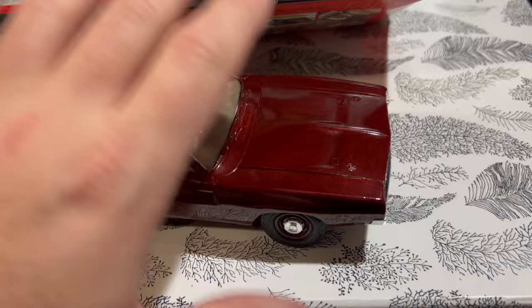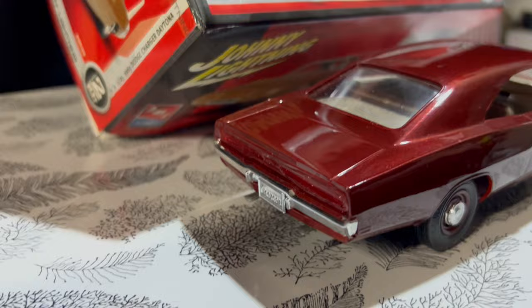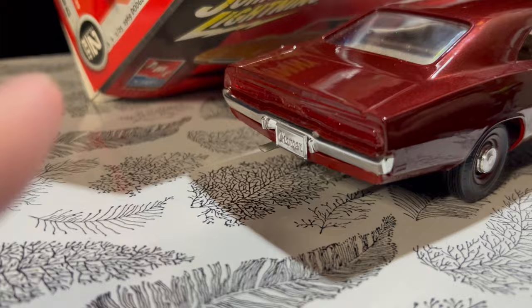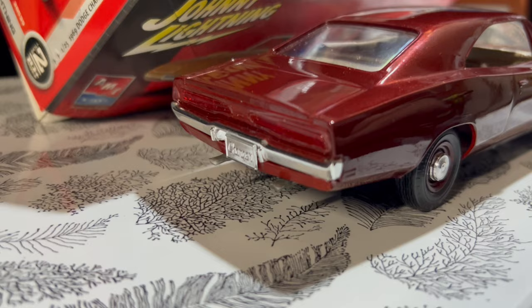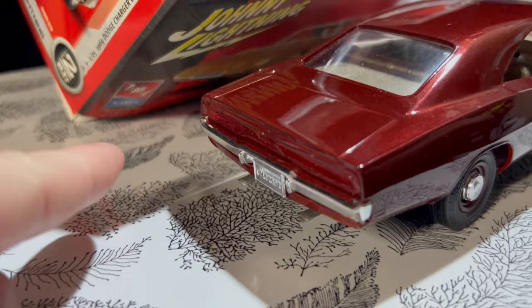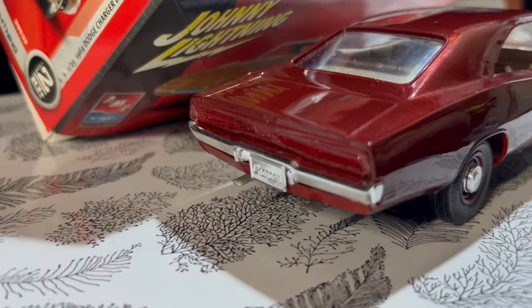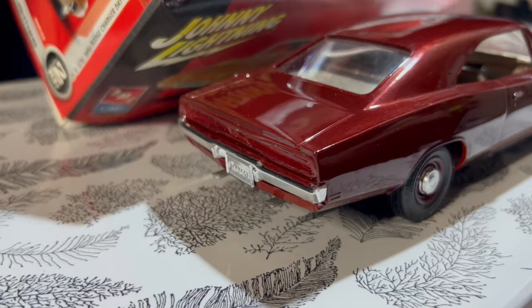A big issue was that the rear bumper did not want to go on the car whatsoever. There are normally two little bumperettes that I had no choice but to shave off because the lower part — as you can see, that red section — is one piece connected to the body and it was warped so badly that I couldn't straighten it out. The Charger license plate actually hides how crooked it is, because there's a split in the middle and the bumper and license plate are supposed to attach and bring everything together. I shaved the nubs off and took those bumperettes off in an attempt to get things to lay flat, and I also had to shave a lot off the bumper and the body to get the bumper to go in.